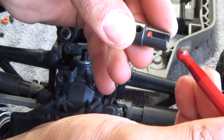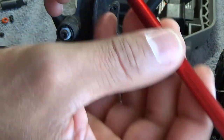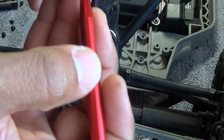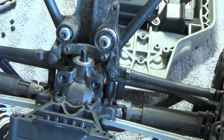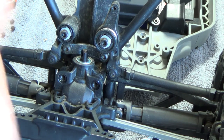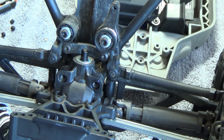I'm going to start with two spacers for now just to see if I even need two. Got two in there, this goes right on. Take a grub screw and we're already almost halfway done. My next concern is the original grub screw is too thin — it would just fall right through — so you have to use the ones that came with the new drive shaft.